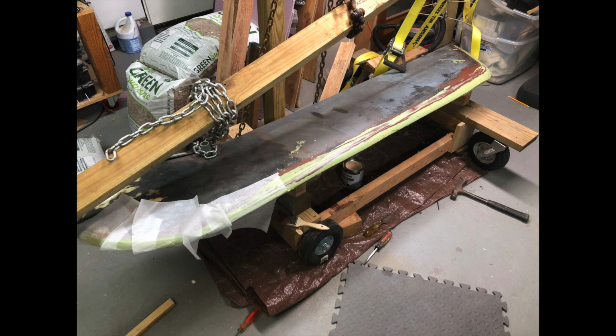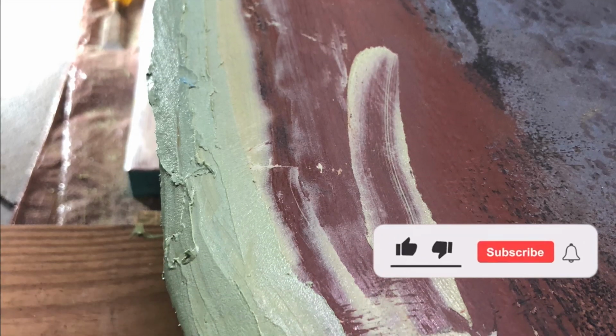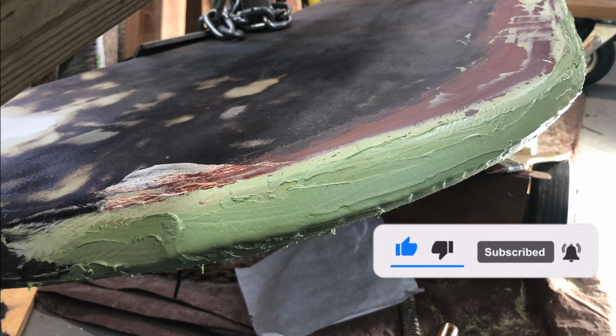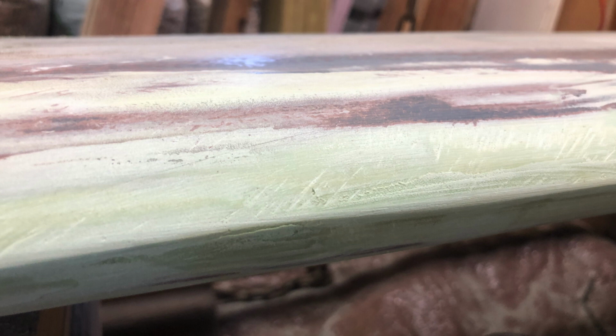Had to do a couple of layers of this just to get the form just right. I have to say, I love that Total Boat product. They don't sponsor any videos or anything like that, but it is a great product. So once I had it applied across the leading edge of the keel, once the fairing compound was dry, I could sand it into the shape that I wanted for my keel. Gave it a little bit of a point.